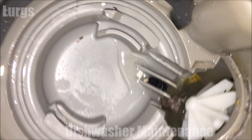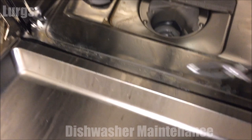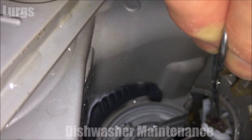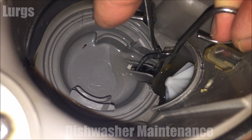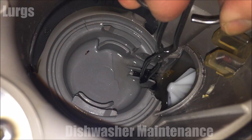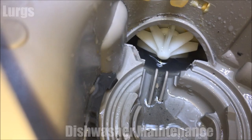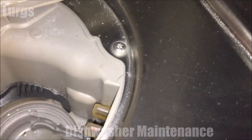Now this is where you get into the nitty-gritty of the inner workings. I've got bits of hair and an old raisin in here. I'm using eyebrow tweezers to clean out any debris — just a few hairs. When you put plates into the dishwasher, always try to make sure there's not loads of food on them. Then get an old toothbrush and give everything a good clean. This is the actual propeller for the drainage motor — just make sure it moves freely, and this one does.